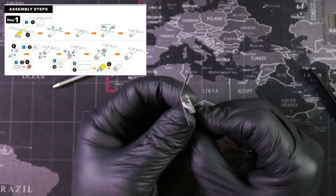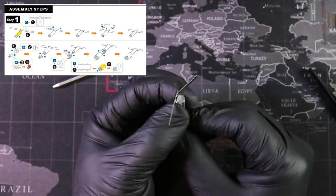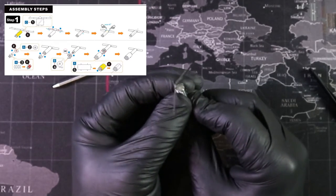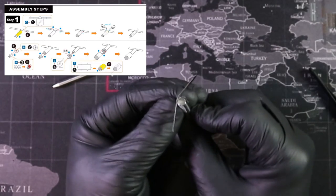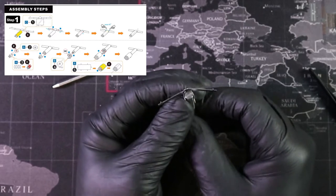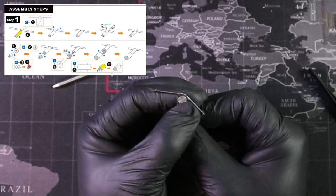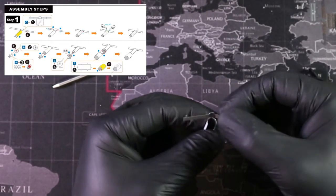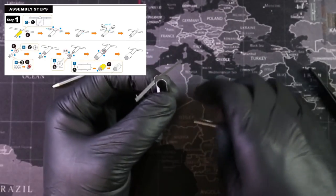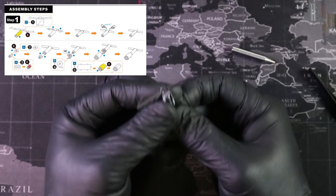The important thing here is to make sure you bend every part of the metal. Sometimes when you push your piece into a tool, little gaps develop — and that's not good when we're trying to make a consistent cylinder. So I go right up to the edges and press them down, even on the tab. Now I'm going to go smaller on the tool.